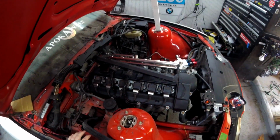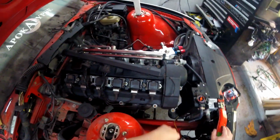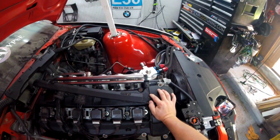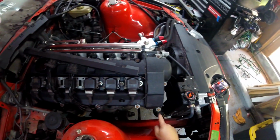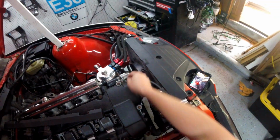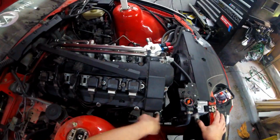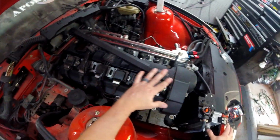So we have a bunch of stuff, but all these S50 coils are going to come off, and we'll get this all cleaned up so that we can take all of our bolts off. As you guys can see, we had this wrinkle black powder coated, looks absolutely fantastic. Not sure if this is gonna be for sale or we're gonna hang it up on the wall for some wall art or something, but the one thing we do need to do on that we're saving are these bolts. As you can see, these things are rusty as all hell, and that's because we at one time sanded and then polished these, but they have since rusted, and we want something that looks good for these. So we are gonna resand these and repolish them so that they match the valve cover. But let's get all of this stuff off and cleaned up.